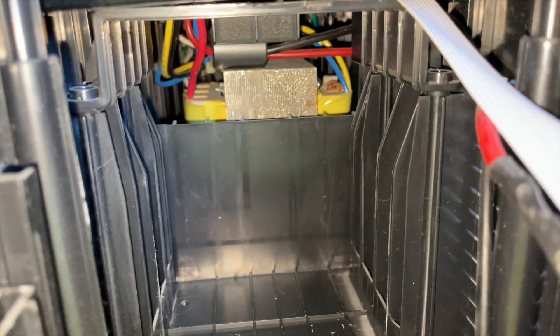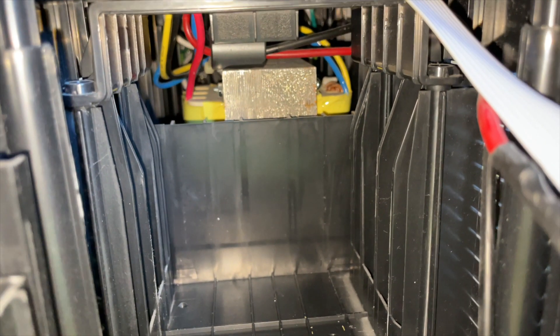If you're curious you can now take a peek inside and see the transformer and other electric components on the other side of the UPS. While it's safe to work with the batteries and their 12-volt voltage, do not under any circumstances touch anything on that other side, even when the unit is unplugged and the batteries are removed. There might be capacitors still carrying mains voltage, so be very careful.